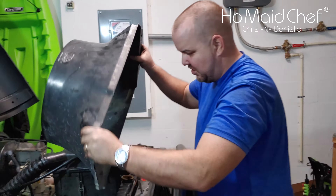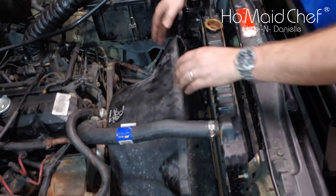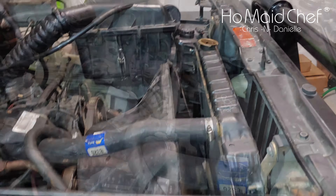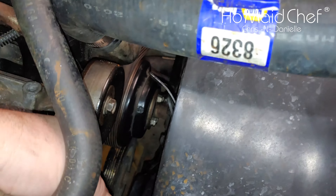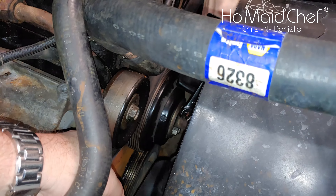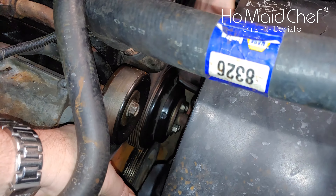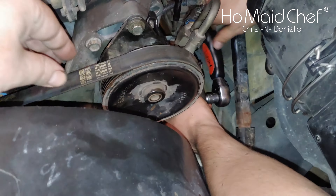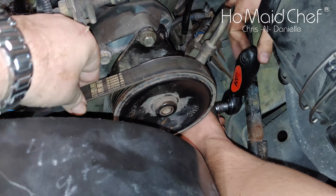We're ready to get the fan shroud in — just drop it in place. When we took this out we were missing some bolts so we'll put them in. I've got the fan back in, I just slid it through the side. Now we're going to tighten up the bolts and apply pressure by pulling on the belt so it prevents it from turning. If we tighten up the belt too tight we won't be able to tighten it anyway because you can't rotate it. So we're tightening up the belt and it's getting pretty tight — I think that's probably good.